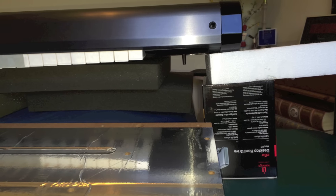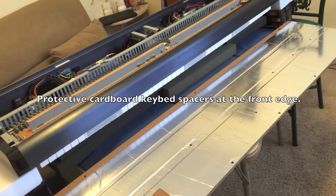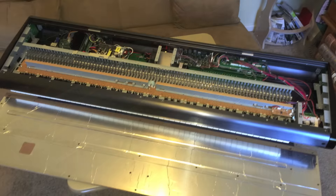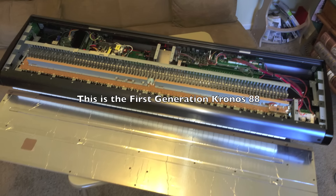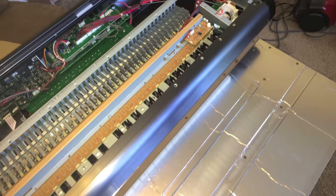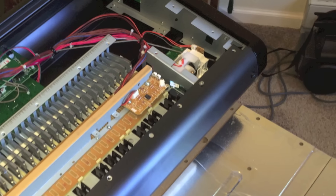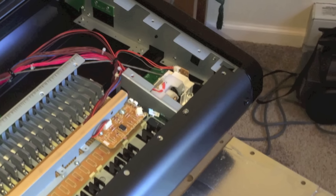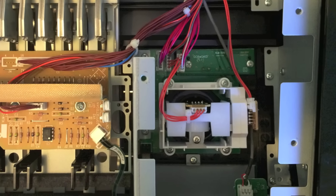Here's a nice shot of the side view showing the spacers and the protection of the key bed, and a beauty shot of the entire keyboard. That silver center rib is the weighted hammer mechanism that gives the keyboard its true weighted action and feel. All the way in the right end corner of the photo you can see the joystick assembly — there are four mounting screws and two wiring harnesses that will have to be removed.